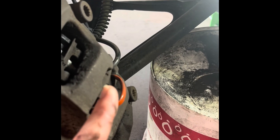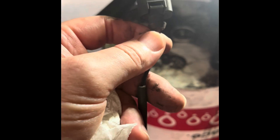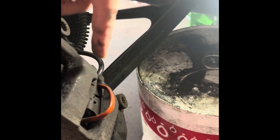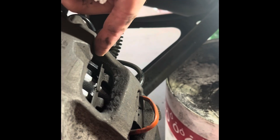Normally my 2004 Cayenne had a two-sensor setup. I ordered this from Amazon and it has two sensors, but the one that came off the car is a single sensor — we'll see what happens. It took me a few minutes to figure this out in hot weather. If you have a dual sensor versus single, it just gives you more information. The easiest way to install is from the side where the cable is — put that in first from the inside and snap it in, then from the outside after the brake pad is in.